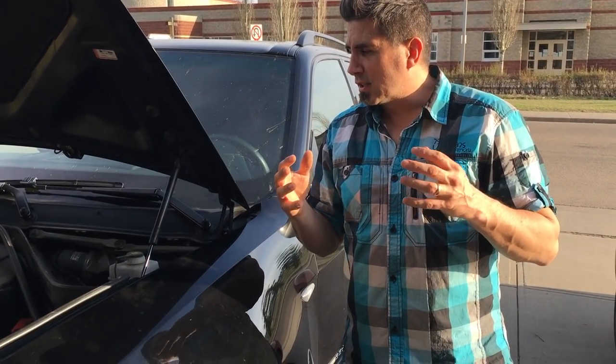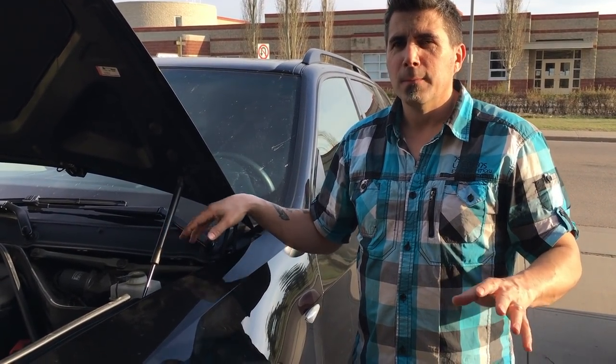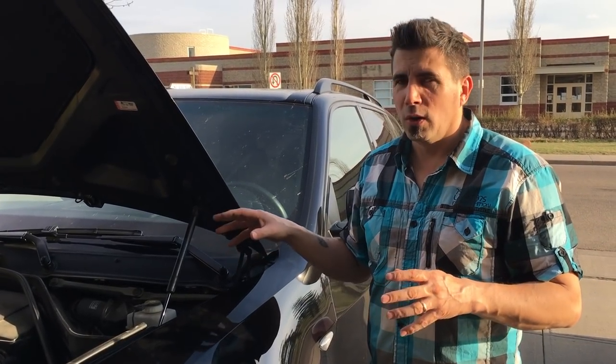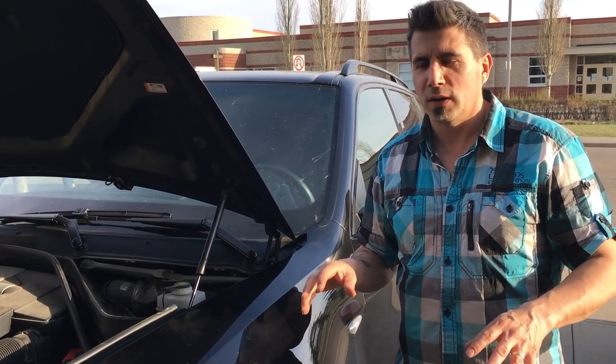The other pointer of course is: do not get brake fluid on the paint. If you pour brake fluid on the paint and don't clean it off, guaranteed that paint will eat away, become disbonded from the metal structure underneath, and you will have a paint job that looks terrible. Otherwise, it's a fairly traditional bleed setup — not that complicated. Just keep the air out of the system. Some guys suggest sucking fluid out of the top, you can do that too, but there's a chance you might introduce air into the system. Once you have air in the system, there's a high probability you'll need to force the outputs on your brake module with the computer. So it's almost just easier to keep topping up the reservoir continually as you bleed each corner.